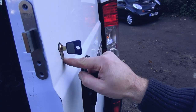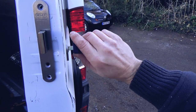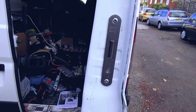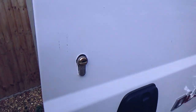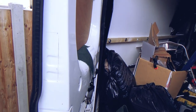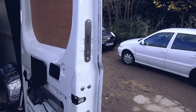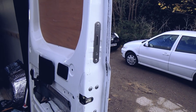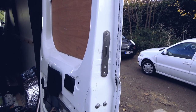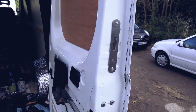Still need to tweak the bottom edge of this because it's pushing up slightly, but it does work. The lock's riveted in — I need to put the decorative plate on the outside, I've got some silicon to seal that up, and I've marked out ready for the locking plate to go in here as well. The first one took me probably about an hour and a half — lots of messing around, but it is my first ever van deadlock. Lots of measuring, measuring, and then measuring again.